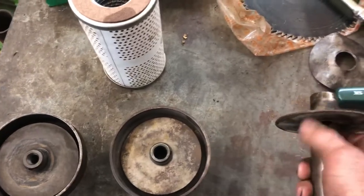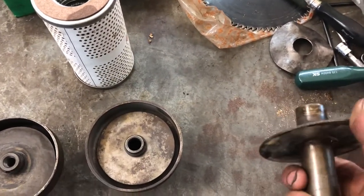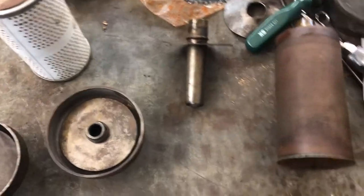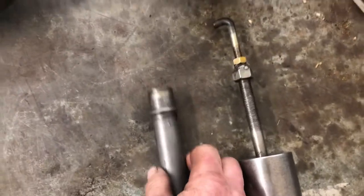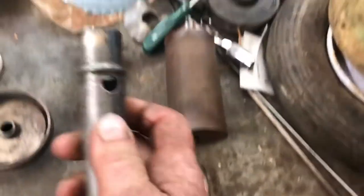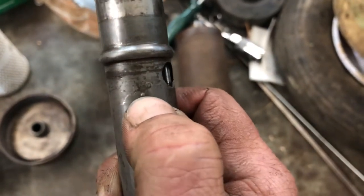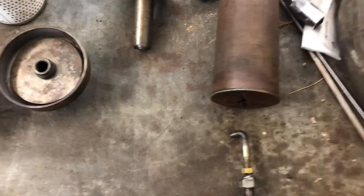So I went down on another trip and found this washer — couldn't get it off, couldn't figure out why. So I made this little adapter jig for my homemade puller, got it up in there and pulled it out. I noticed these little dimples on there — that washer gets pounded up over top of them, and that keeps them from coming off.